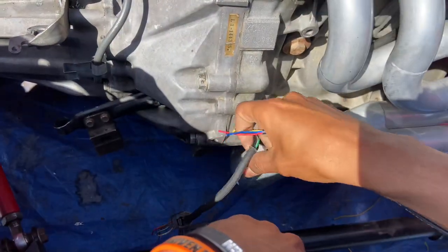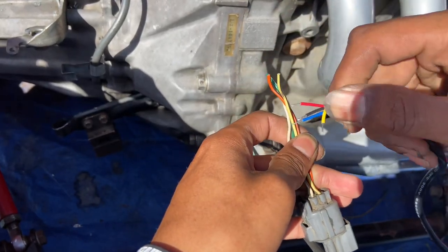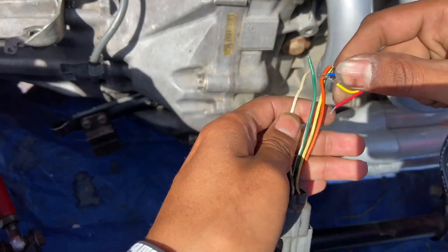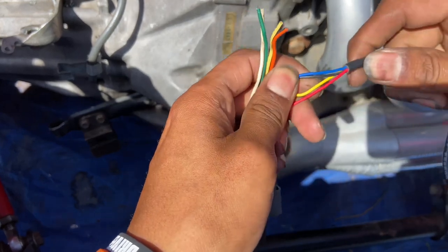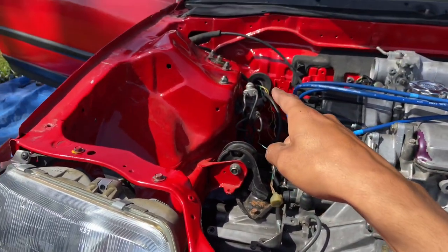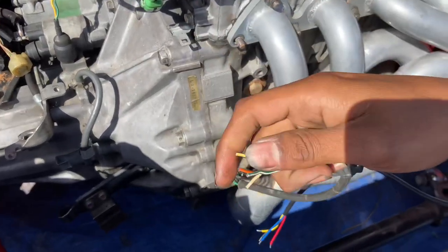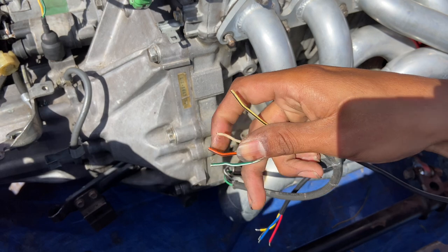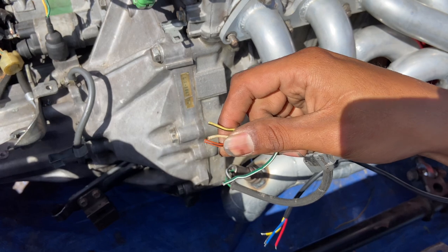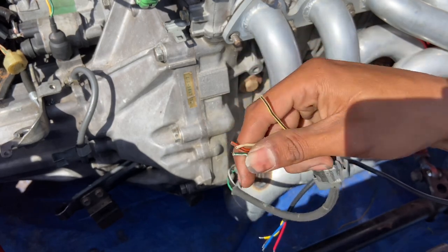Today we're going to tackle this four-wire O2 sensor. We have four wires and Leo provided us this cable which also has four wires. I'm going to assign a wire to each color of this cable, run all of these wires into the firewall through the AC grommet right there, and then figure everything else out from there. The white wire goes straight to the ECU as well as the orange and yellow wires - white wire is O2 signal, orange and yellow are heated O2 and O2 power. I have to figure out which is which, and green is just ground.